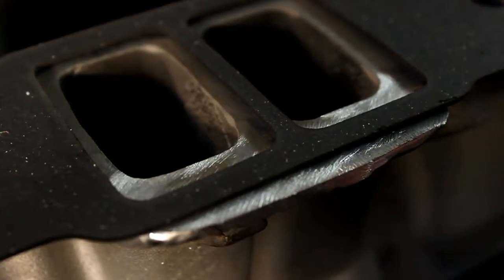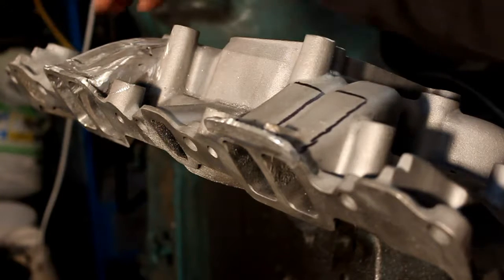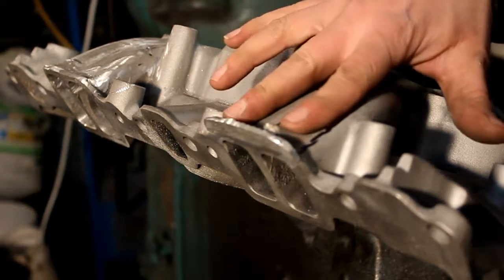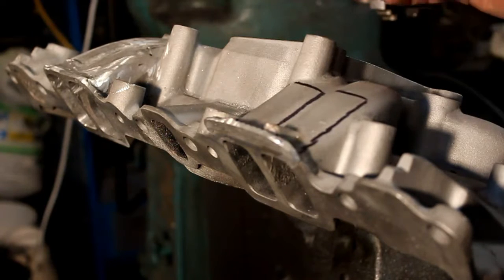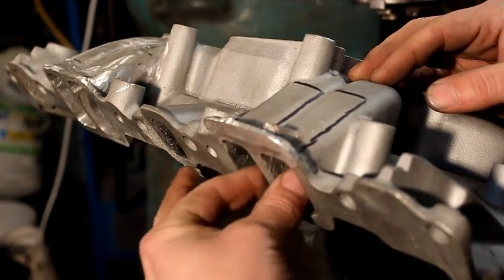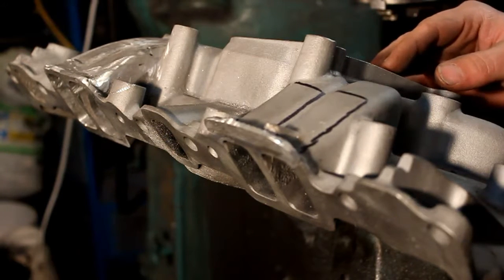So I'm going to mark it and we're going to cut it with a plasma cutter. I've marked it and this seemed to work pretty well over here. I'm going to cut out on these lines and take these two pieces completely out. They're going to be raised up like this to fill the gap. While I have them out, I'm going to hog out the ports and try to port them - especially the center piece here - thin it out, and get back in here and clean the intake out.